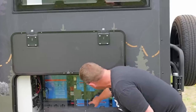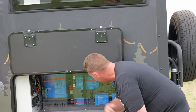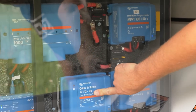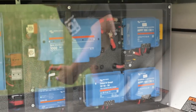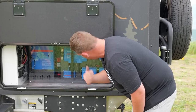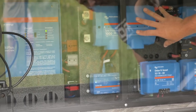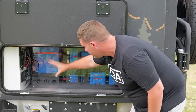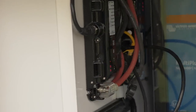There are a couple of screws and the whole plate comes out so you can service it and work on it. We have two solar charge controllers — one for the roof, one for the briefcase. You also have a DC-to-DC charger, which allows you to charge while towing with your truck, putting a lot more power into the batteries as you drive down the road. And then of course you have the servo and the distribution panel, and a 3,000-watt inverter. We have all the Garmin system right in this area as well.